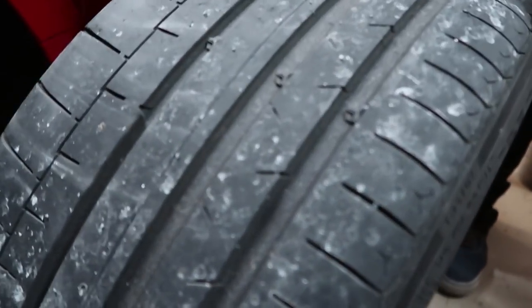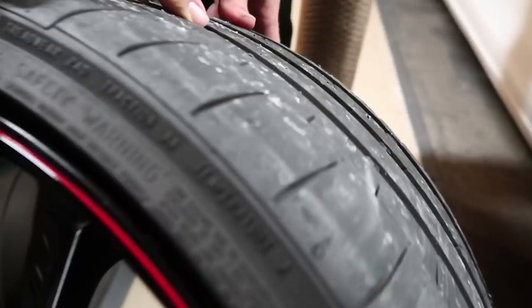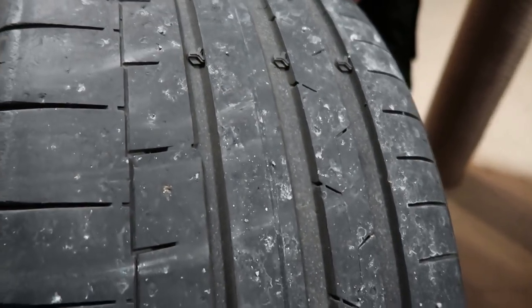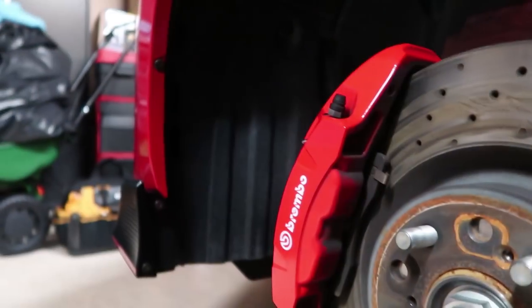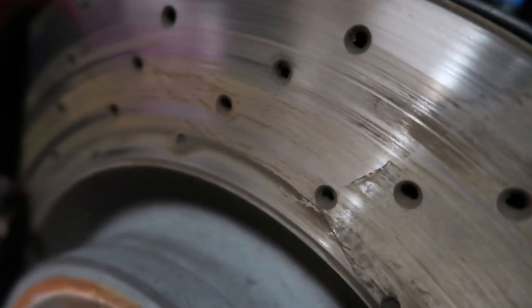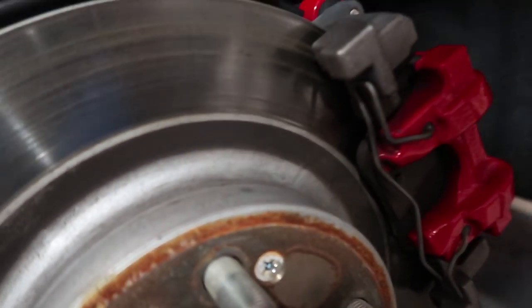Taking a quick look at these tires — they have 10,000 miles on them and they don't look that worn out. Looks like they have at least 5,000 miles left, depending on how he drives. Way better than mine, which only has 3,000 miles but has three track days on it. David never took it to the track, that's why it's still in good condition. Now is also a good time to inspect the brakes. After 10,000 miles they look okay — a little more worn than mine, but what you see is just a little bit of pad material, not a big deal. In the back, same story — looks good, does not need a brake pad change any time soon.